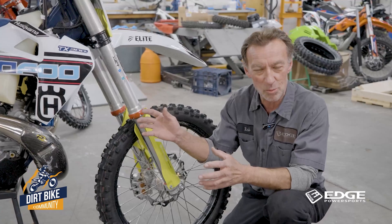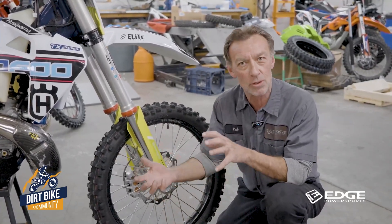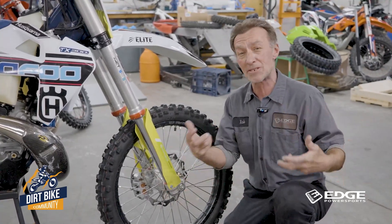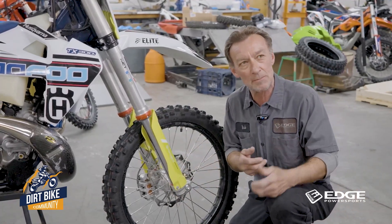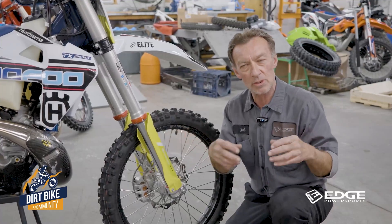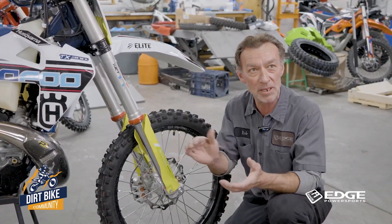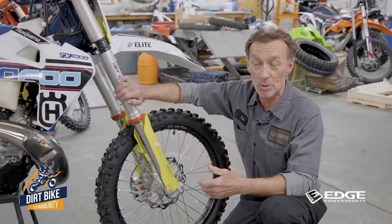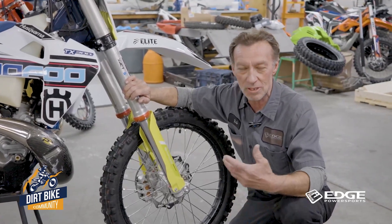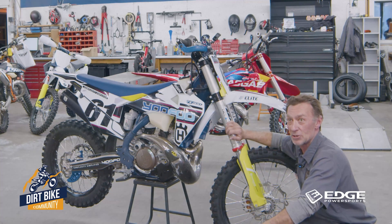When riding enduro, I've modified my bike so I can race supermoto and also do hard enduro with two sets of wheels. On the racetrack I need things more taut — not bouncing around as much. But at a local spot like AF Canyon with lots of obstacles, I don't want it as taut because every time I go over an obstacle it'll deflect me. On the track I'm about 10 clicks out; up at AF Canyon I'm 15 to 20 clicks out on compression. Fiddle with your suspension and make it your bike.